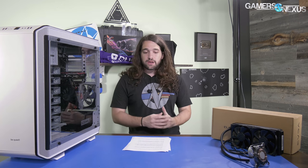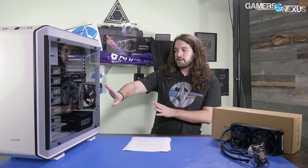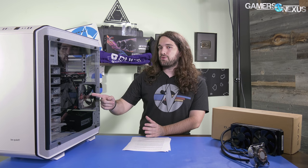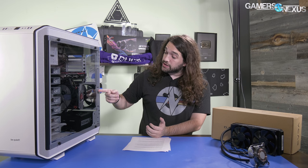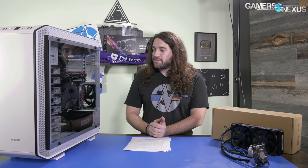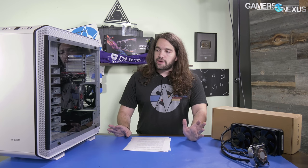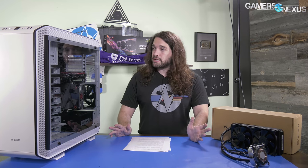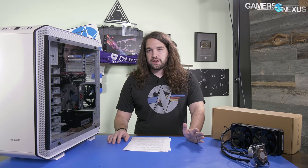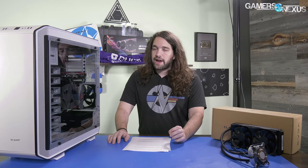Case testing is ultimately one of the most difficult things to test because you can only really test for the configuration you built. The inverted layout being significantly better for CPU thermals is because we're using an air cooler — the tower cooler is now in a straight line from the rear exhaust and the front intake of both fans, basically an optimal setup. If you're using a closed-loop or open-loop liquid cooler, orientation really won't matter much — all that matters is where the radiator is. This is representative of a tower cooler configuration with a dual-axial fan.